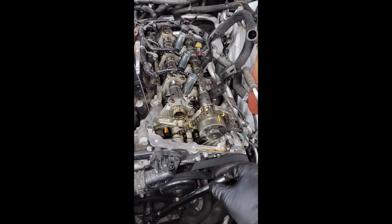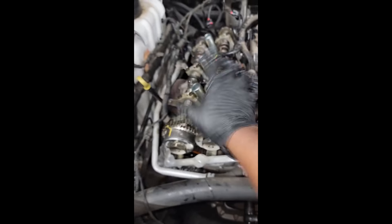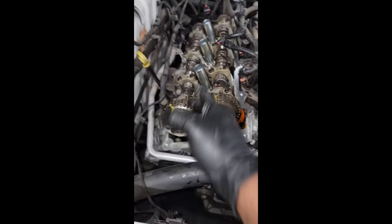Verify that the lines are lined up side by side — that way you know cylinder one is all the way up. You probably forgot to mark it, but either way: rotate the engine to bring up cylinder one, or remove the valve cover and look. That way you can be assured you're at top dead center.